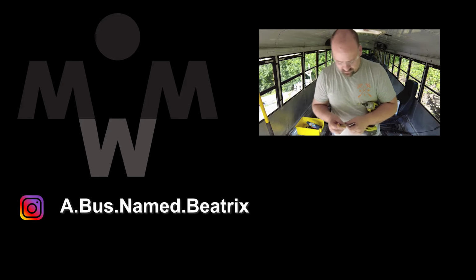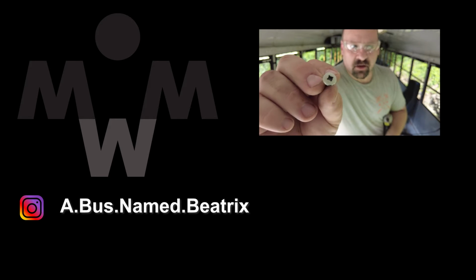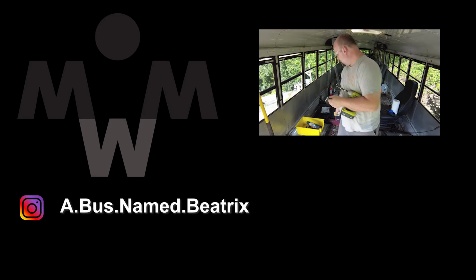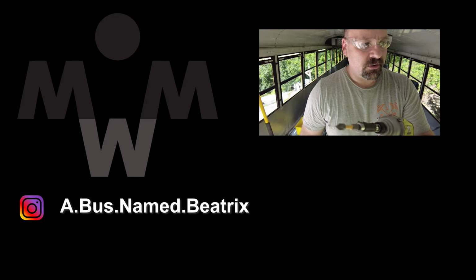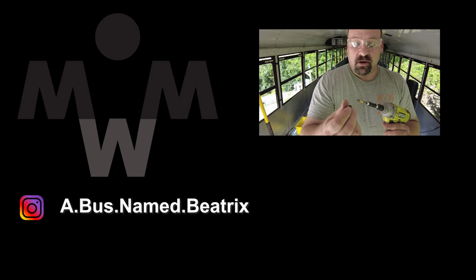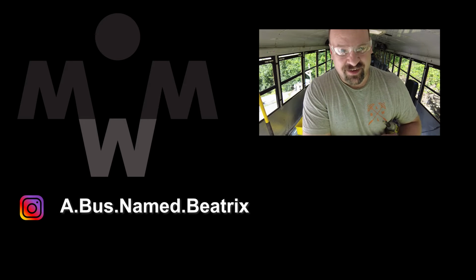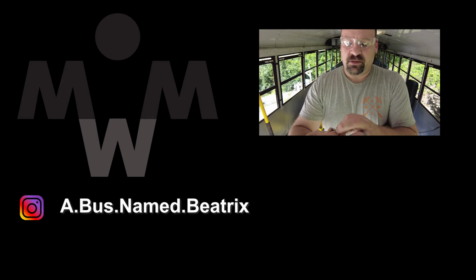Okay, another fun fact. So, on a Thomas bus, there are about 1 billion of these screws. Now, people will tell you, or people will assume, that they are a number 2. It's hard to do this upside down. They'll tell you that it is a number 2 drill bit. And the number 2 will fit in there. And it'll almost fill it up. But it'll cam out easy. A number 3 gets in there and gets out to the edges where it'll actually really give some torque.